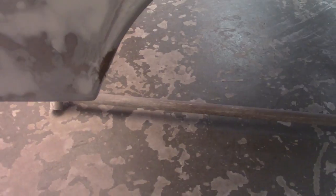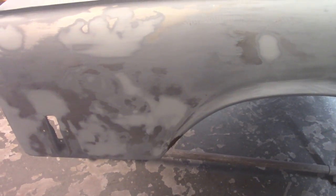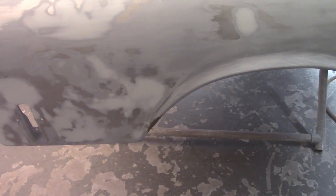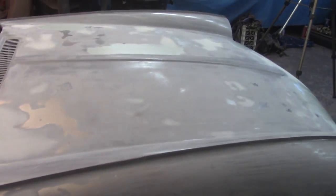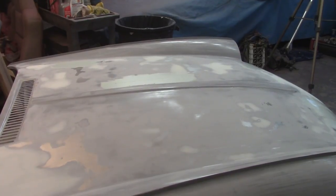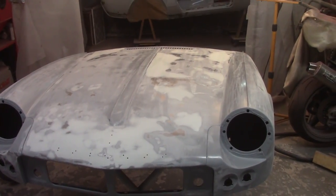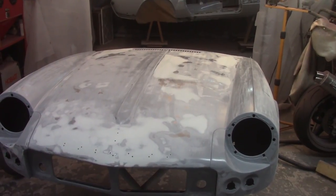And then I finally remembered to get the little divot that I had sanded into the wing of the flare a long time ago. And got that on pretty good, and that's just fiberglass there because I want some added strength. So that'll just clean up, and I'll sand a lot of that by hand to kind of fair that in. So give it a couple more minutes here, let it cure up a little bit better, and then I'll get to sanding.